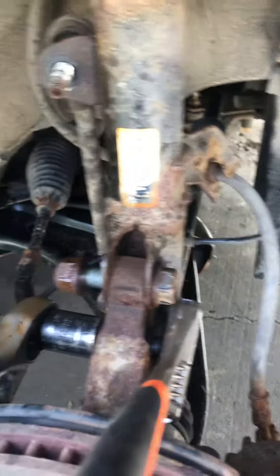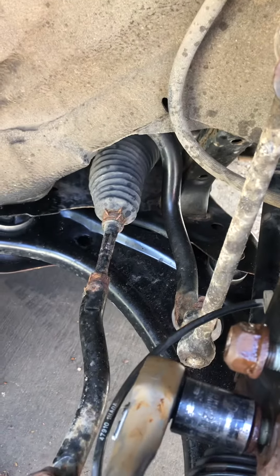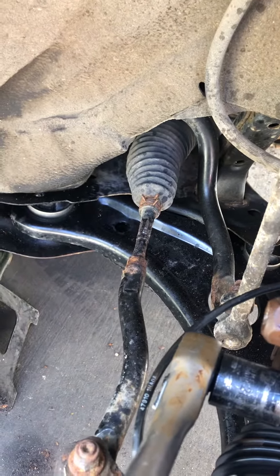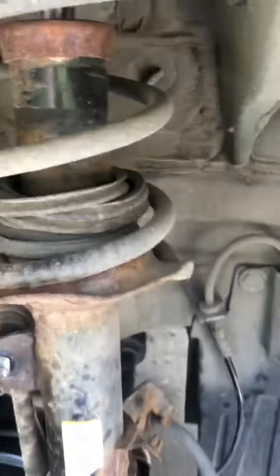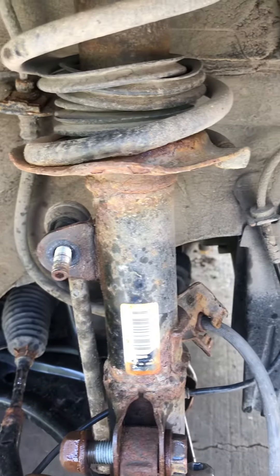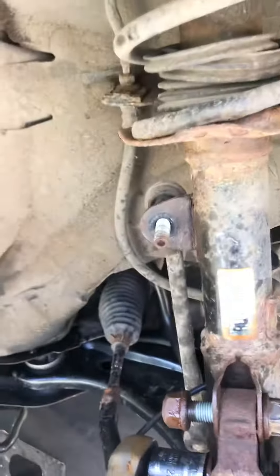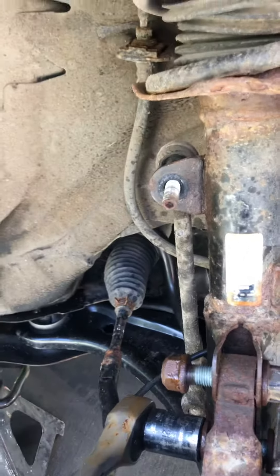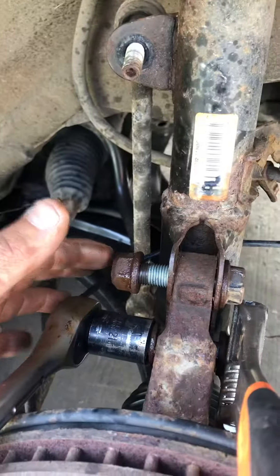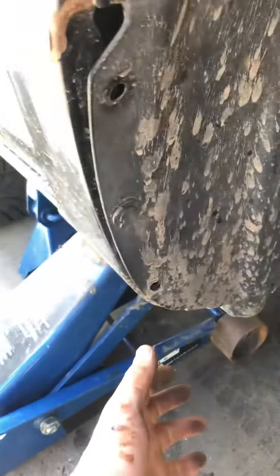You need socket and wrench on both sides. I did my control arm and alignment, and it ended up saying your shock is no good. I'm not so sure if it's true or not, but I have to do it. I got a used one here for a hundred bucks — just two bolts, 21 and 16. Get a floor jack and secure it.